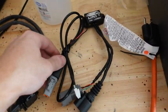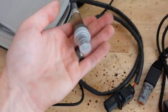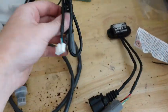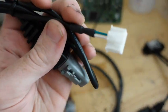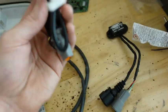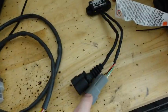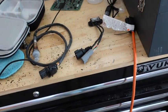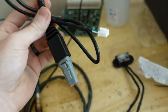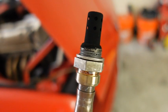With the Link CAN lambda kit, you get this piece and the O2 sensor — the thing that's actually reading. Naturally this will go in the exhaust and then plug into the other side of the CAN lambda sensor. You also need to order this connector piece, and I unfortunately ordered the wrong one — this is a 5-pin and my HC20X ECU is a 4-pin. The other one is coming in the mail. All we really need to wire is a power and a ground; everything else is just completely plugged in.